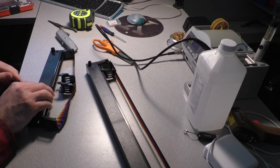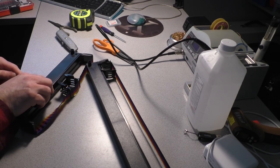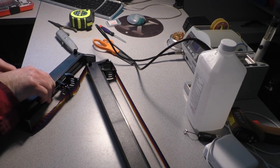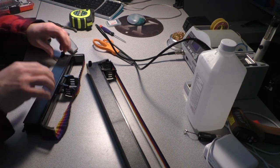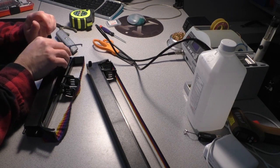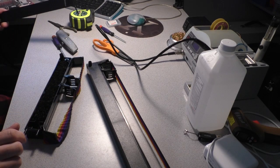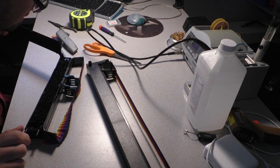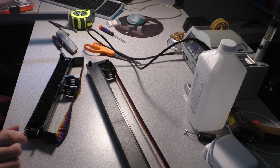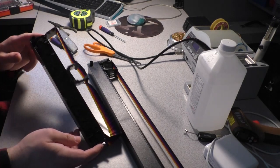While I have it apart, I want to share with you a trick. If you've got some ribbons for printers that you're just no longer able to get ribbons for, and there are some out there for sure, you can pop these open, the black ribbons more so than anything. I found the splice, or the tear, right there. So that's what it looks like when it's all inside its cassette.